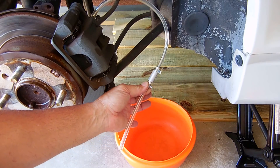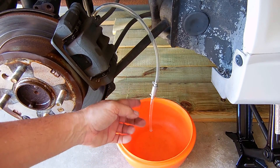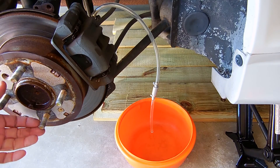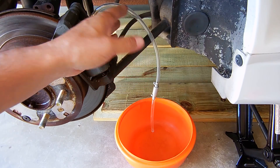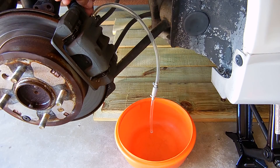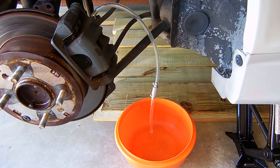You don't have to use a check valve like this one — I'll place a link in the video description if you want one, as it makes it very simple to bleed brakes by yourself. If you don't have a check valve, you can use a straight piece of vinyl tubing. Make sure the end of the tubing is submerged inside brake fluid, because as you push down on the brake pedal the fluid moves forward, and when you lift the pedal it retracts slightly — you don't want to draw air back into the system. Loosen the bleed bolt, get in the car, and slowly push the pedal all the way down and up, down and up, until you see clear fluid flowing through the line without any air bubbles. While doing this, make sure the reservoir is kept full — you do not want it to go dry and draw air into the system.